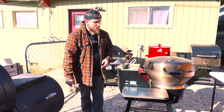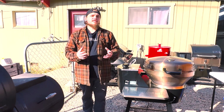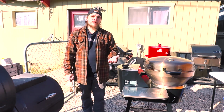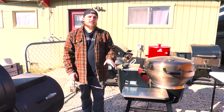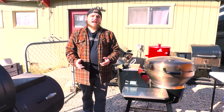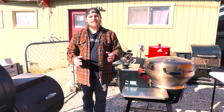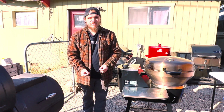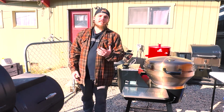That Wi-Fi is a big plus though, and the fact that they've included 5 gigahertz to help with newer standards and keeping up with technology is a big plus. Now a lot of pellet grill manufacturers don't include that because these grills really don't need the bandwidth that 5 gigahertz supplies, and the range of 5 gigahertz over 2.4 gigahertz is a lot shorter and smaller. It has a lot harder time getting through walls, and so grills outside really have a hard time taking advantage of 5 gigahertz only.